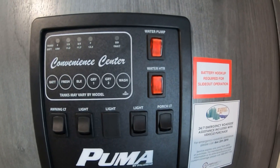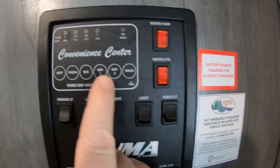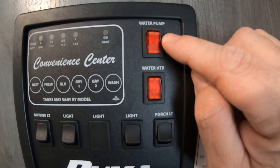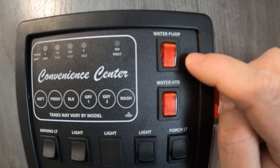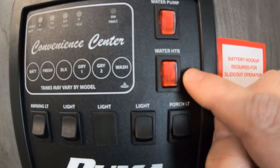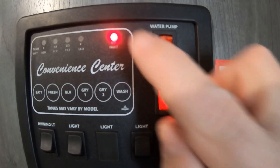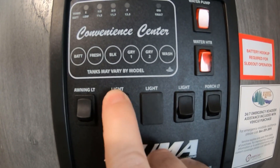By the door is your main control panel. Push these buttons and it'll tell you how your tanks are and how your battery is. As you push through you'll see the readings — the battery reading will go down as it loses charge. Here you have a water pump — this is only needed for dry camping when you bring your own water and need pressure to the sink and shower. Don't leave it running if you don't have water in the tank or you'll burn it up. Next is your water heater and gas switch. The little red light means there's no gas — when you have gas, you want to see it come on for a minute then go off once it fires up.